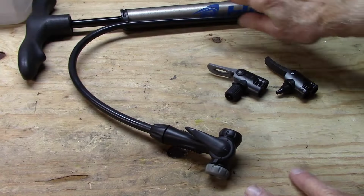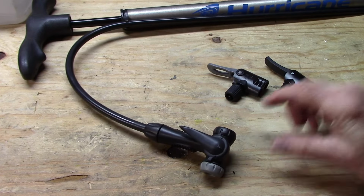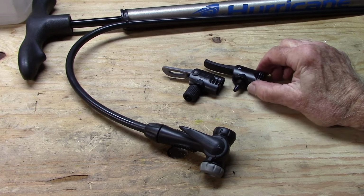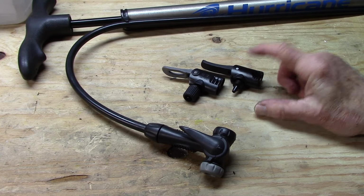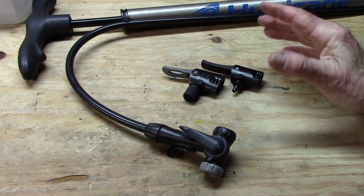In those pumps where the piston and cylinder look fine, the tubing is not cracked, but you have a problem with the pump chuck, it is possible to obtain a new chuck for just several dollars. They're made in China, by the way, and depending on where you buy them, if they're present here in the US and you have it shipped, you'll get it in a few days. If they're shipped from China, it'll be a few months.